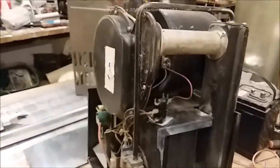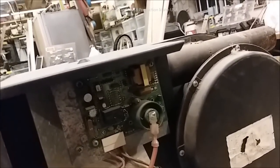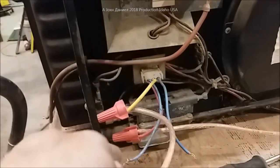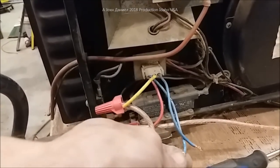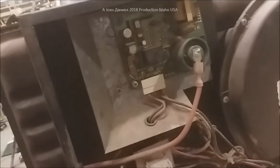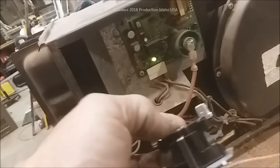Let's get this screwed down, flip her over, and fire it up. Now we've got it put back together, the time delay relay is installed. I'm going to show you the side of the board — a few functions on what it's going to do. The power is a positive-only fire-up: you've got positive there and positive here. Once you make the loop as if your thermostat is in line — the thermostat makes the switch contact of these two points, pulling only about an amp — I'm going to put these together. Now the furnace has been activated. The blower will come on here; it's on a delay while that bi-metal material inside warms up to make contact.